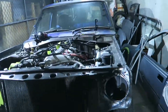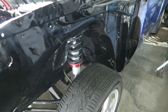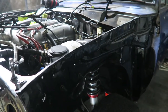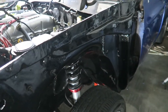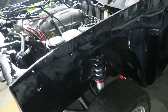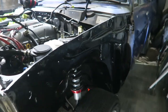Quickly talking through the suspension: these are coilovers for the front from a local builder here, Nick Cross. He does a pretty good job. I've got the same setup in the B310 and it handles really well — it's quite compliant and soft, not too hard, so handling is pretty good considering what a stock one is like. I've seen other ones that don't have the tender spring — the extra little spring that gives it a different feel — but these work really well and I'm looking forward to them.